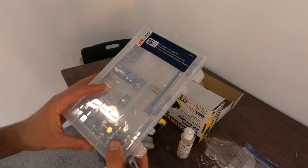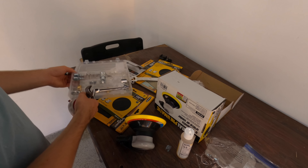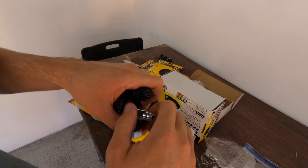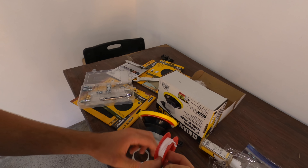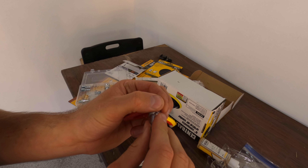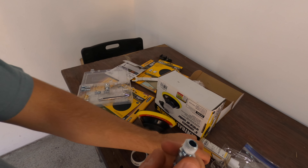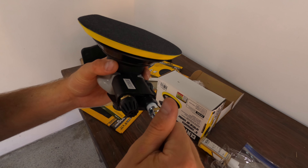Next step in the process is an air compressor starter kit, or something that has any of these adapters that you need. This is the tip that hooks up to the air compressor, and we're going to need to put one — thread one — into our palm sander. Before we do that, I'm going to grab some teflon tape. I have links to all of this in the description, don't even stress about writing it down. Do one kind of thin layer, rip it off, slide it on there nice, and then go ahead and start threading it in by hand.